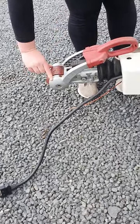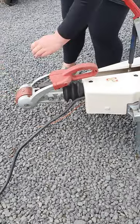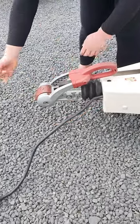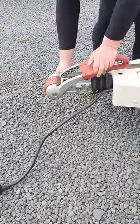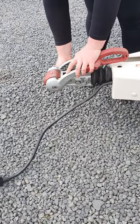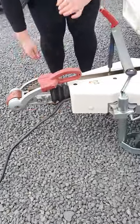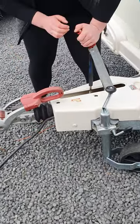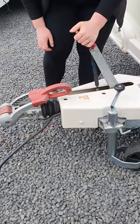There are Alco brake pads in here that'll squeeze in and lock onto your towball. You do have a breakaway cable. This is designed to loop around the towball and clip back onto itself, so that sits underneath the hitch. If for some reason this hitch ever gave away, this breakaway cable will pull, snap off and put your handbrake on. Your handbrake, much like the car, push down for off, pull up for on.